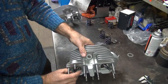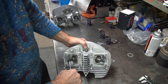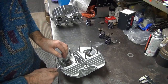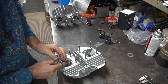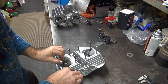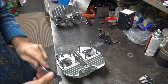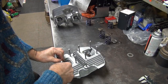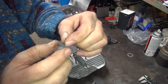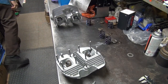You can have a little bit of seal material on the guide, on the valve — you need to get that off. Let me see if I have a pair of dikes by chance. You split it in half and beat them out, but in this case no go. That one came off in a complete 360, so it's hard to get off. This is the wrong seal — this is 5/8 instead of 9/16, and it's gone. In the trash can.